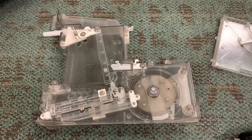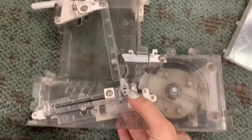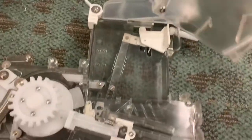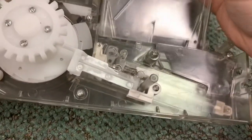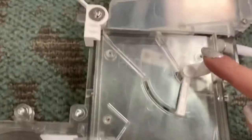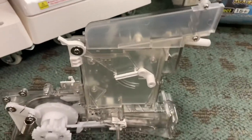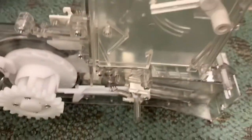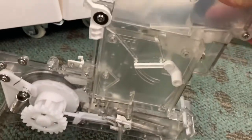Now we're going to insert it back into the machine. Now that you've finished repositioning the screw and the arm, the arm piece itself should be able to press down — you can see it right through there — so it's not blocking the coin. Let's put this piece back on. Lever up so it clicks back in place. Make sure the lock is down. Put the token in and now it has gone past that spot down to the bottom, where you can press the trigger release or crank the wheel to pay for the toy.